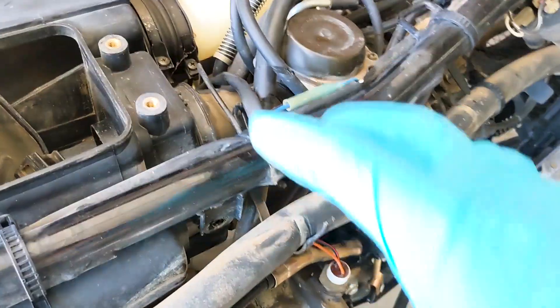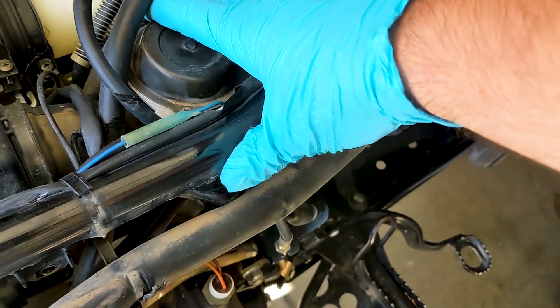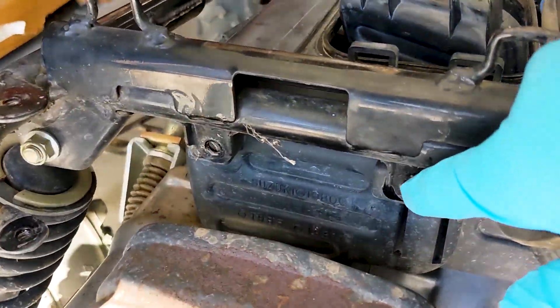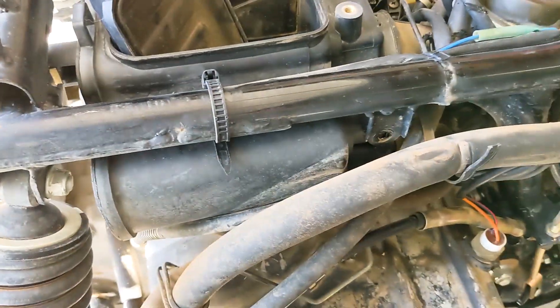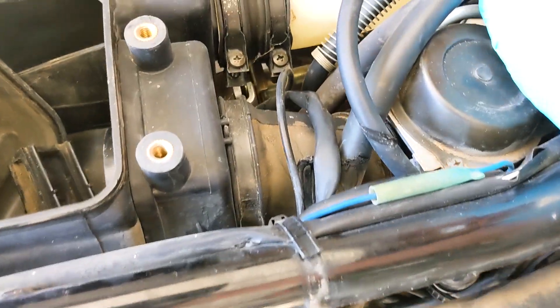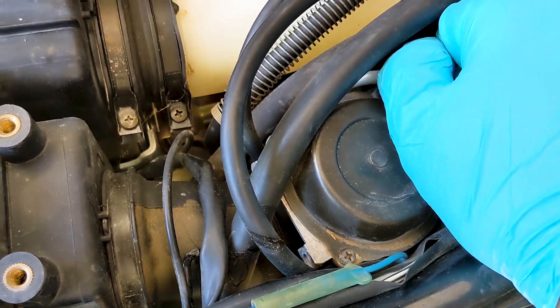To take out the airbox, I need room to get to this. The hard part about working on quads is that they are really tight in there and there's like support braces right down the side. I'm taking out the airbox — there's one bolt that goes here and two to go here. Stock size is 10 millimeter. Be sure to loosen these screws when you go to take them out so these boots don't get ripped.